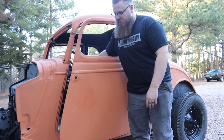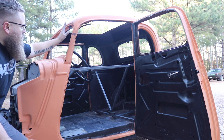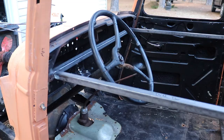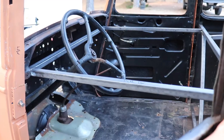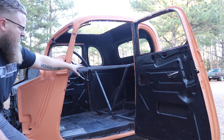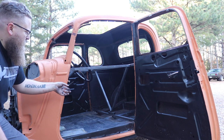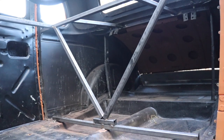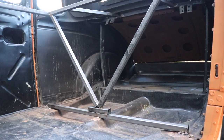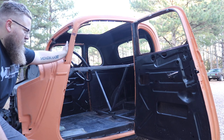Here's what we've got going on in this one. The way I go about adding that structure is with one inch by one inch square tubing — I believe this is 14 gauge. Thicker is fine, it's just more expensive, but 14 gauge does the job just fine and it's fairly affordable. I have six five-foot sticks inside this car right now holding this structure. I had to add an extra square tube just to make up for the length I didn't have. So if you're working this exact 1934 body style, I'd say go with seven sticks of five-foot square tubing — that'd be perfect with a little bit left over.